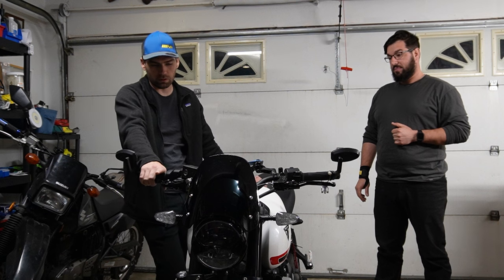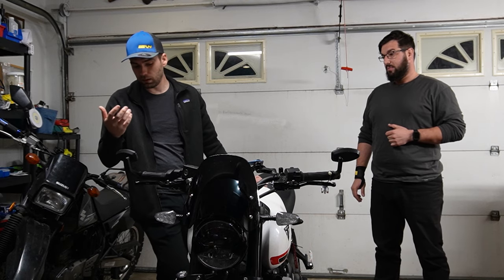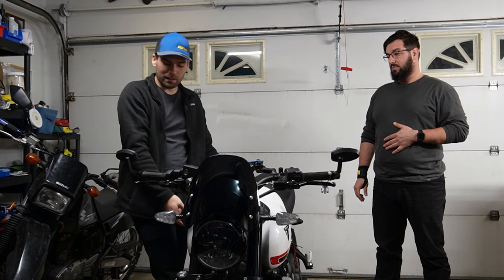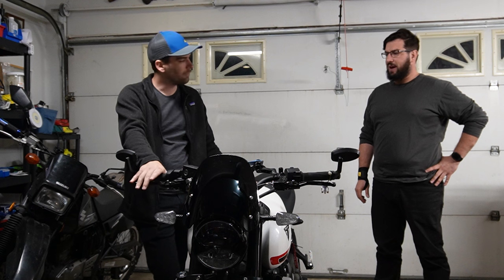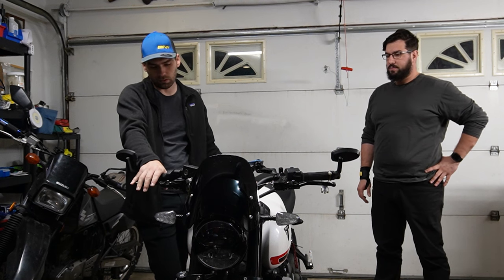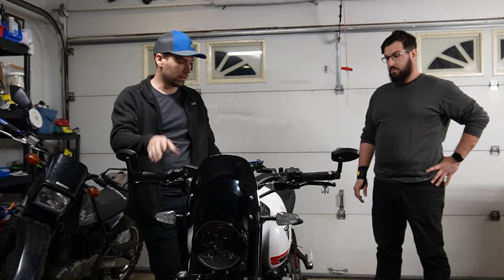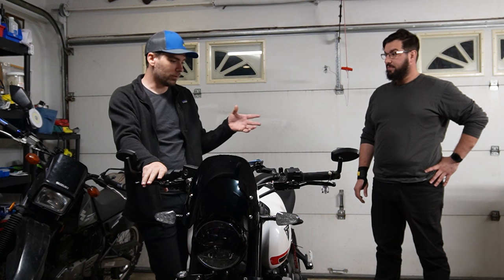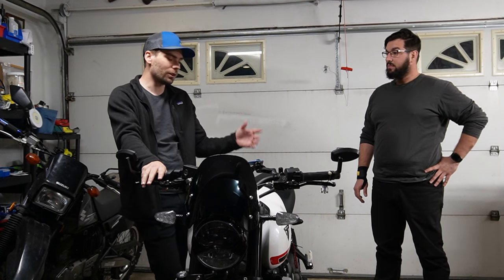I think we could use another bleed. After you do a fresh flush, you have new fluid in there, and some bubbles will work their way down, so it doesn't hurt to do another one. It's been about 500 miles, so maybe that makes sense. That's just a recommendation I would make, but they feel good, and you're getting a stronger bite. Like I said, we went with the street level pads. We didn't go with a track level pad.